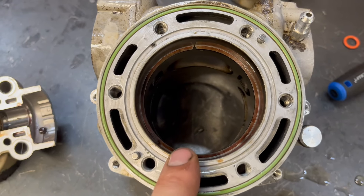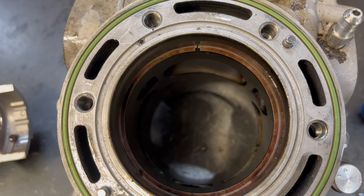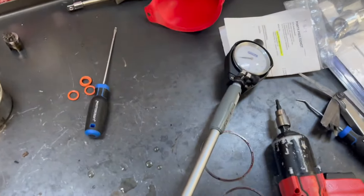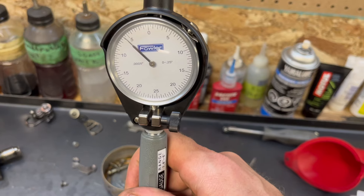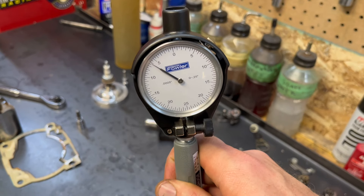Now let's get on to the two most important pieces of information about top end wear. I got 18 thou there — ideal it should be like 13 or 14 thou, but I don't know what it was set up with at the factory. I'm going to check piston clearance — at the factory this will be set up at two and a half thou. I've got my bore gauge zeroed here — just over five and a half thou. Let's check the bottom: same, five and a half side to side. That's perfect. 100 hours, five and a half thou, which means that the piston has worn three thou off of its original skirt. I could go a little further, but I would say 100 hours is right about bang on for my style of riding.